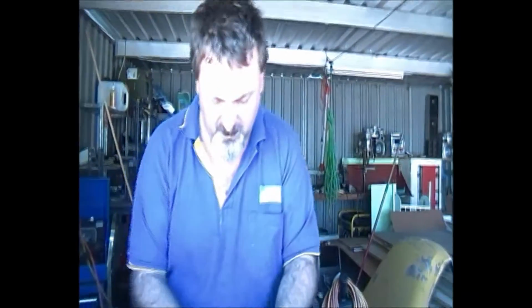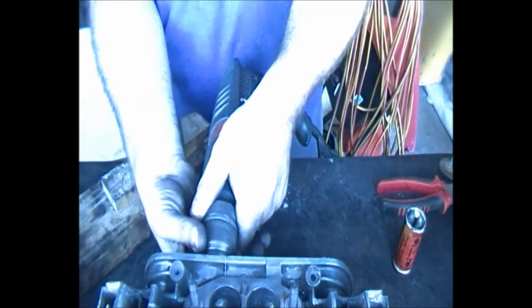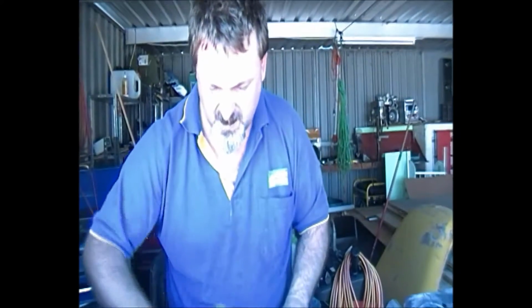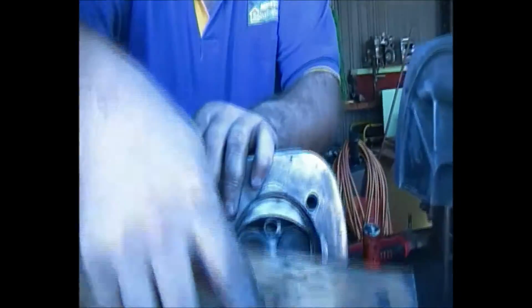That is to tilt your cylinder head over, grab your old trusty drill out, and just marry it up onto the back of the valve. Set your drill to the lowest possible speed. So this is only really something that should be done if you've got a variable speed drill. And I don't know if we'll be able to see this. I might actually have to sort of block the head up a bit so you can see it.